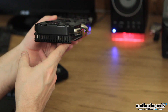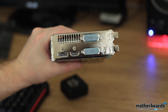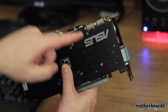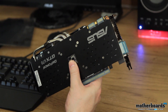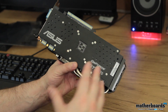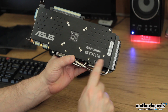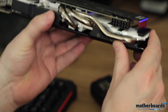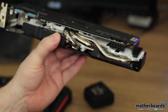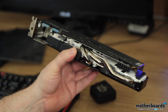Flipping around the back to show you the rear I/O — I like this rear I/O. We see two DVIs, HDMI, and a standard DisplayPort. Up here on top, we see the two SLI fingers. I also really like this back plate covering the very back of the card — that's very good. If you want to set the card down, you don't have to worry about getting it shorted out or scratching anything. You can see it's the ASUS GeForce GTX 670. And here are the two six-pin power connectors — one cable came inside the box, and most likely your power supply will already have these cables, especially if you have a newer power supply.